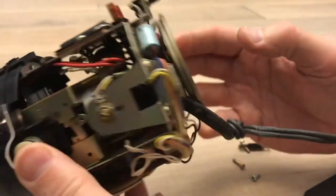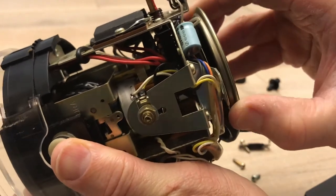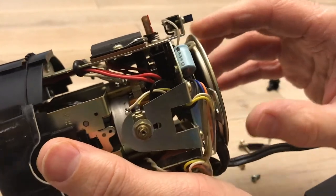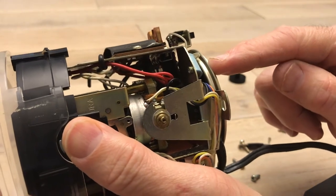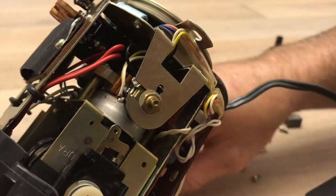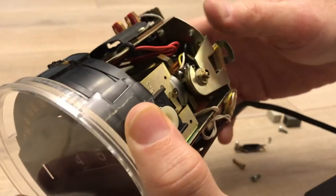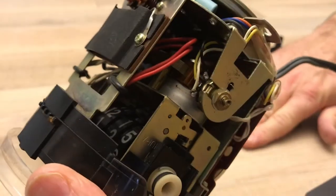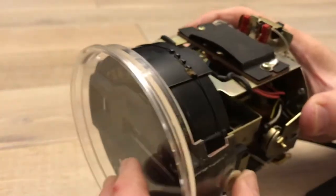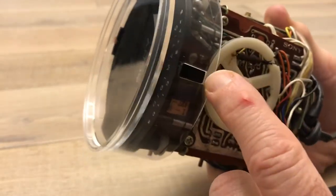Look how compact this is. That's a little speaker on the back — it's actually stuck inside a rubber donut, and that donut is glued onto the metal structure. Mine had come off and I had to put it back on with silicone rubber glue — it's actually a glue used for washer and dryer felt, a Whirlpool product, and it works really well for stuff like that. The engineering here is just amazing to get it all in this small space. We've got a tab here and two tabs on the top, one on the bottom, that has to be cleared.